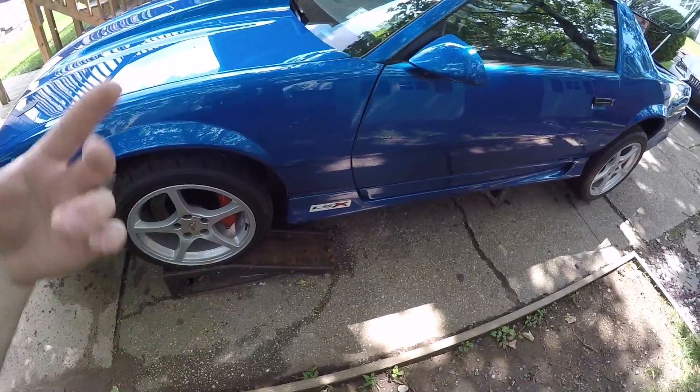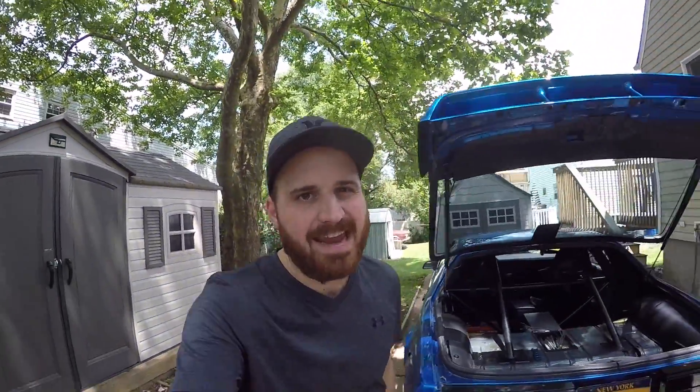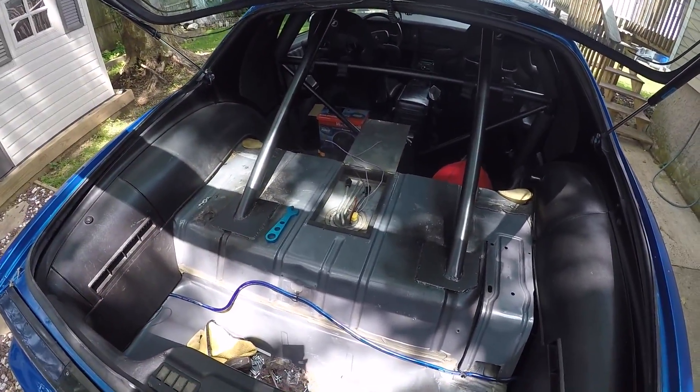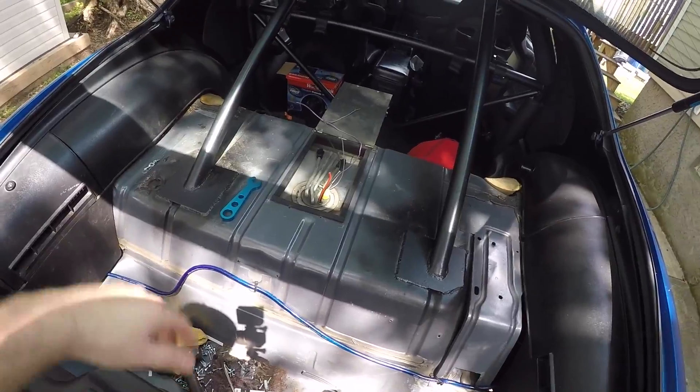Little by little she is coming along. Still lots of content coming - I still have to do the meth kit, the intercooler, get the actual blower on the car, and work any kinks out. I'm still waiting on the accessory drive for the blower, and once that comes in I'll be able to install the last LSX Concepts piece, then measure for a belt, and we'll probably be ready to start it up. I did pick up a set of Siemens Deka 80-pound injectors - those are ready to go, which is really going to be the last part of the fuel system. Link to my Instagram is in the description - I'm always posting progress pics. If you enjoyed this video please like, comment, subscribe, and I'll see you next time.